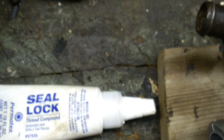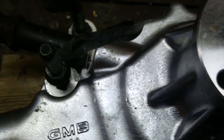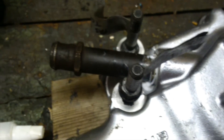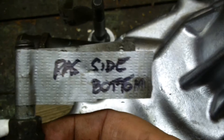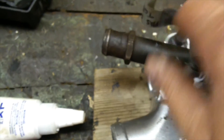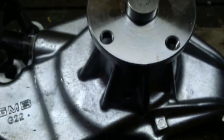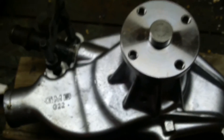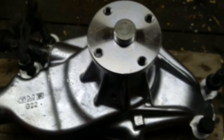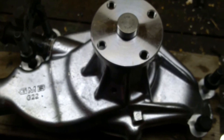Something you may want to do when you're taking things apart — at least I have to do this — you never know how many weeks or months you'll be before you get back to it. If you can't place it back in the block for whatever reason, I always mark stuff with some tape: passenger side bottom stud, passenger side top stud. That way there's no way I'll forget when I get back what bolts go in what position. It makes things a lot easier.